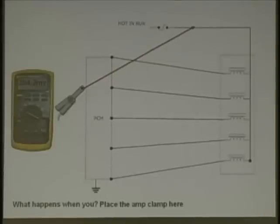How much would be the maximum that you're going to read? Yeah, that's a good question first. What's the max on that circuit that I should read? We just went over this. 1.2 amps per load, 1, 2, 3, 4, 5, so 6 amps is basically what that thing should pull max, thereabouts, correct? 1.2 each. Everyone understand? Times 5. That would be the max that you would expect.